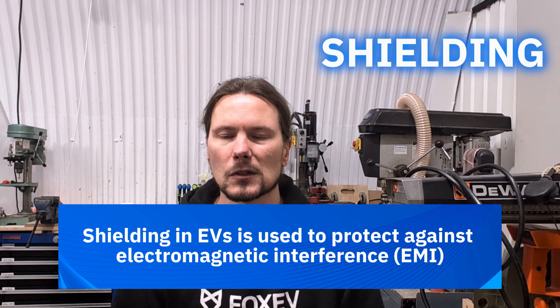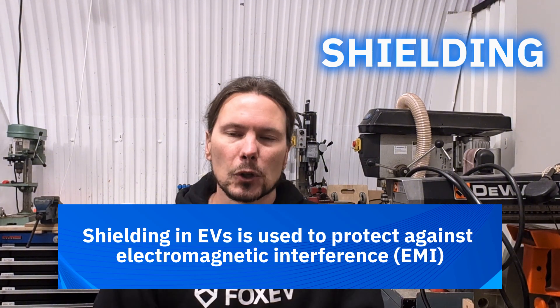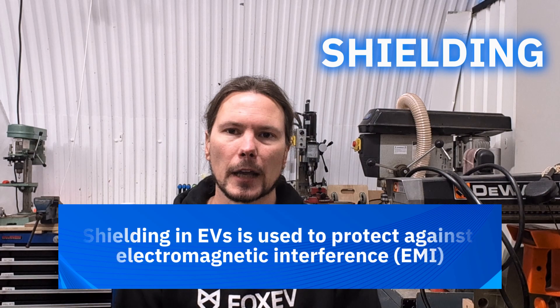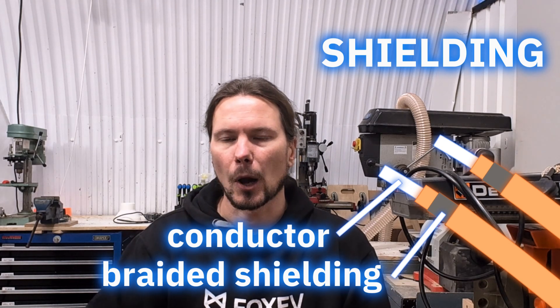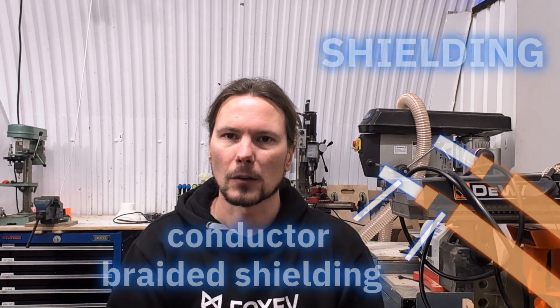The other concept is shielding. The inverter is electrically very loud — it switches on and off really fast to drive the motor, creating electrical noise. You don't want that noise in your control systems or interfering with sensors. So as best as possible, you wrap the high voltage bus in a Faraday cage. The wires are often covered in braided steel shielding, and the devices on the bus are built to close the Faraday cage around the bus.